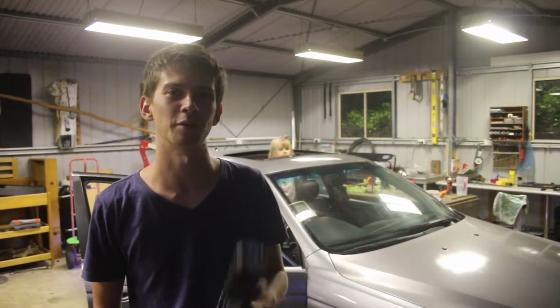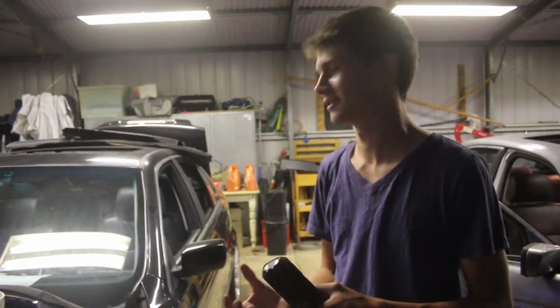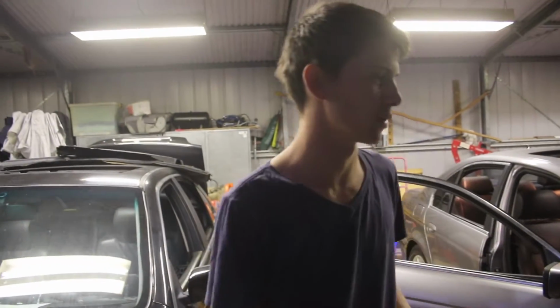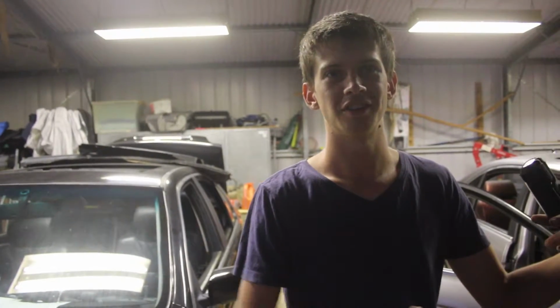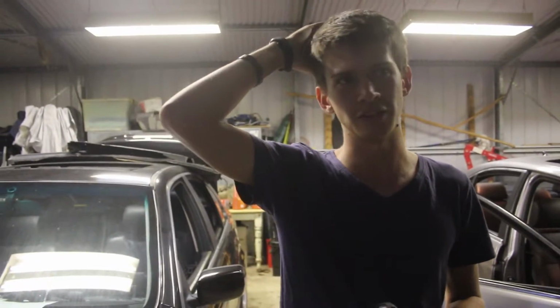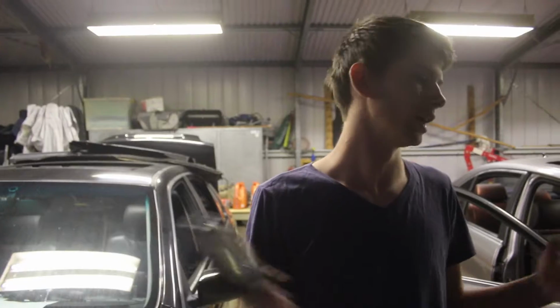So change the radiator cap, no longer spitting out fluid. Kind of makes sense that maybe that's the problem, but I'm not convinced yet, because if we have a blockage somewhere else, that's going to build up pressure, right? And if it's building up pressure, either the place where we have the pressure is going to go, or the place where there's a blockage is going to go, or it's going to be another location. So the seal in that first cap might have gone because there was a pressure blockage somewhere else. But we'll take it for a drive and see how it goes.